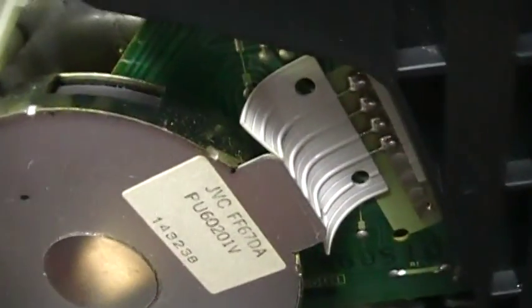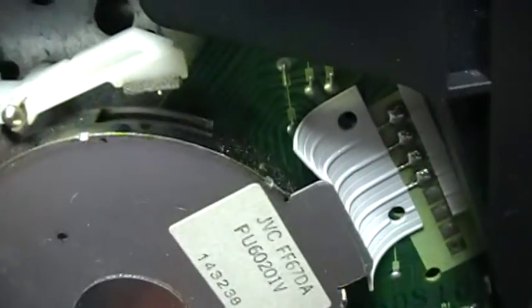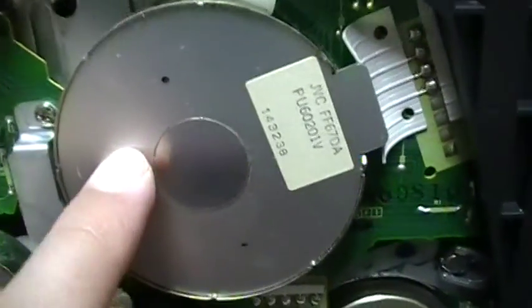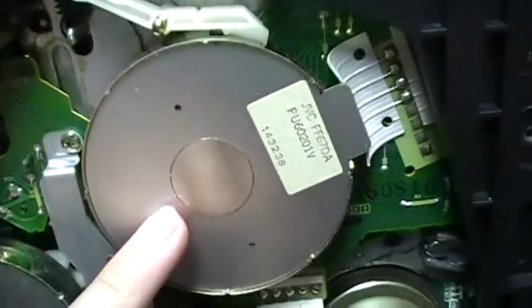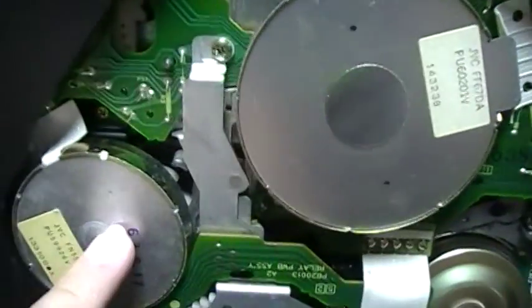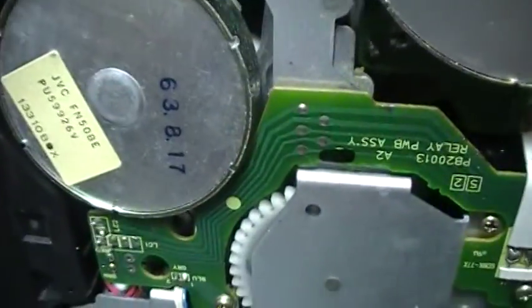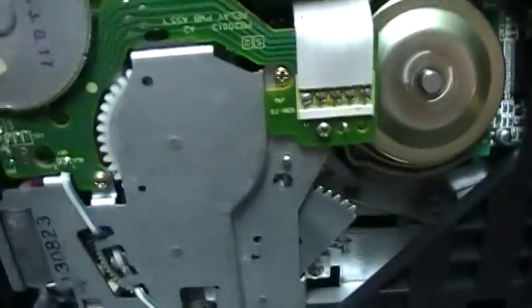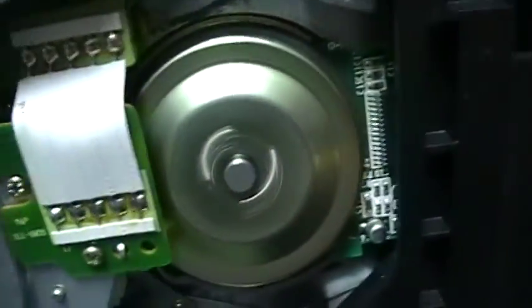Because we can see the part that turns. When I press pause, it's brushing the capstan motor. Because when it's on pause, this motor always turns, but the capstan motor is not turning on pause. When you do slow motion, it's this motor that turns. It's too bad the picture shakes, but the mechanism works fine, so that's the important thing.